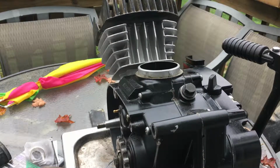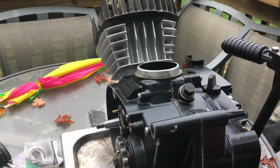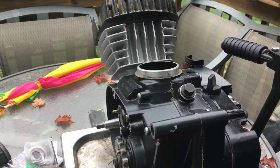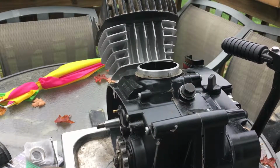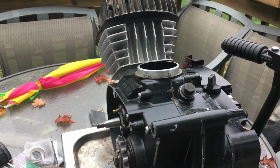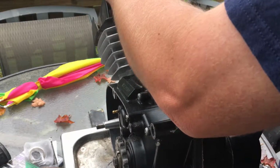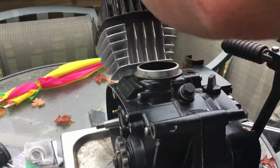And which direction we're going to go in. So you guys got to see a little bit more about the combustion chamber, the way I'm doing it, the way I'm taking it. We're going to do a platinum plug on it. So we're going to get rid of that plug that's in there. Because of the heat on it, we're probably going to drop it down a heat range. And I'll explain to you all that when I go and do it. See how it works.